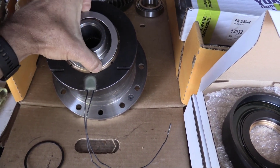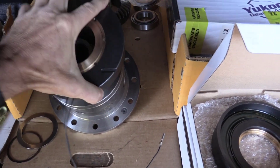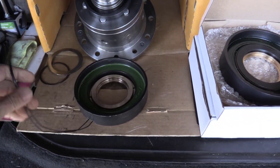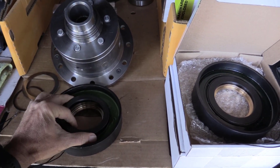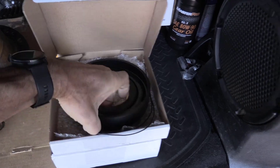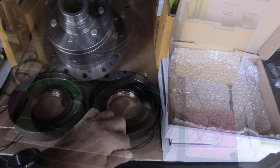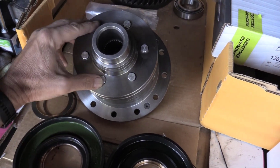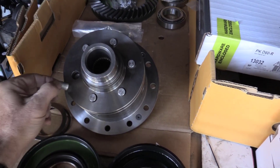To pull it apart, remove the spring clip and then the thrust washer — the coils pull right off, leaving the metal actuator ring. The new electromagnetic coil and the metal ring were shipped as a set with a single part number. When the magnet is engaged, the metal ring presses down on the aluminum dowels to engage the spring-loaded locking mechanism inside the carrier housing.